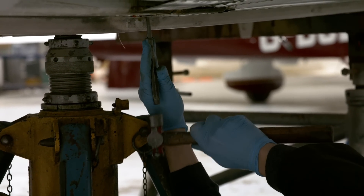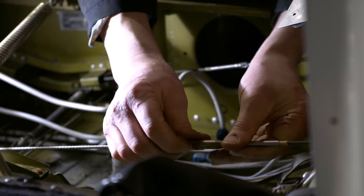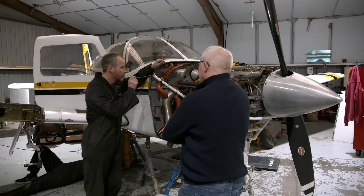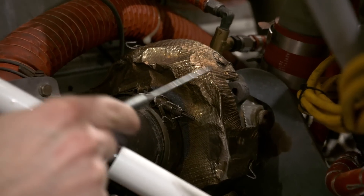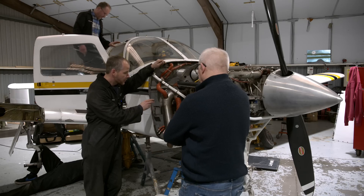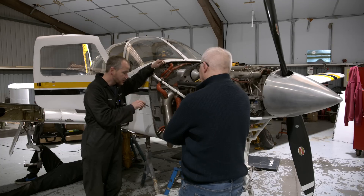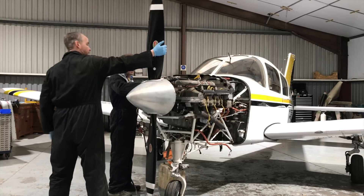They're almost ready to take the wing off, but before they do that John fills me in on more of the tasks completed during the annual inspection. We've had a look at your exhaust system. The turbo in particular needs to be carefully inspected, because any leaks there can burn a hole in your firewall, which isn't good news. Underneath the cabin heat exchangers, if there are any cracks or perforations in the exhaust, you'll be getting carbon monoxide into the cabin. So those are stripped, removed, inspected and pressure tested. We've done your compression checks.